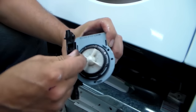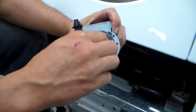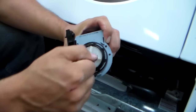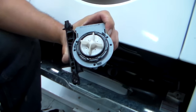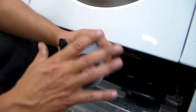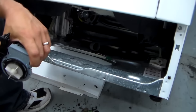Now this will pop apart and here's your propeller — or impeller, whatever you want to call it. If you have sand, grime, stones, or anything like that in here, I have seen it stop this from moving. This is where you want to clean it out. You can spin it freely now — that's what the inside of your front load washer drain pump looks like. You can go ahead and put that back together and put the rest of it back together because we're done cleaning this out.